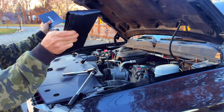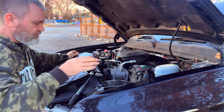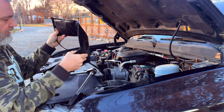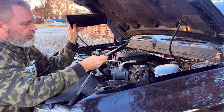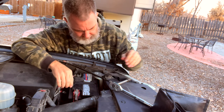We'll probably wait till tomorrow when it's nice and cold, plug it in about two hours early — that's usually when I plug in the block heater. I've got two batteries; I'm going to put the under-battery pad on the far left battery since it's closer to the starter and likely does most of the work. I have higher hopes for the wrap-around one because in testing it got hotter, and the way it goes around the battery on three corners I feel like it'll be more effective.